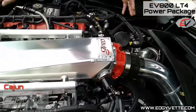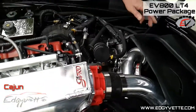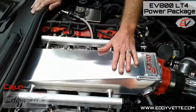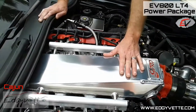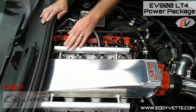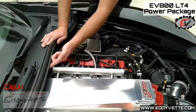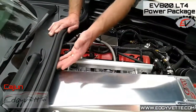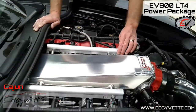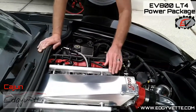The PTS kit is pretty simple — turbo routed to the intercooler, blow off valve, and back up to the air intake. What we have here is a G1 Pro aluminum street level intake and the G1 Pro custom fuel rails. These are a lifesaver because they give you the ability to mount the fuel rail without notching the cowl or doing any adjustments to the C7. Most people don't want to cut on their car to put a Holley fuel rail under here, and G1 Pro has addressed that with these really nice smooth fuel rails.